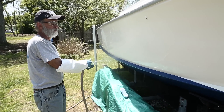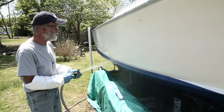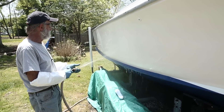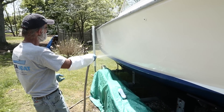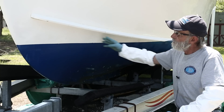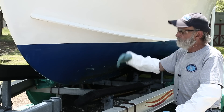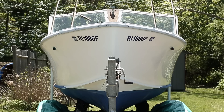We've just finished rinsing off our second application and you can see it's removed almost all of the stain — if not all of it — and it looks great. A couple of pointers about rinsing: don't point your hose straight at the hull because the water splashes back and gets you wet, and we're rinsing off oxalic acid here, so spray it at an angle so the splashing doesn't get back on you. Look how well it worked — this was the area with some of the worst staining and it's all removed. Now the thing to do is buff it, wax it, paint the bottom, and put her in.